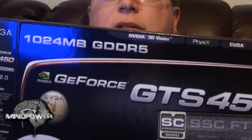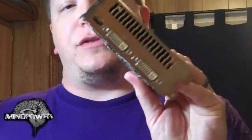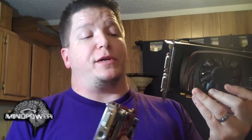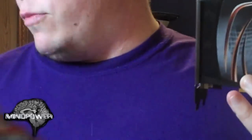The video card I'm going to install here is an EVGA GeForce GTS 450. It's really a rather large contraption — most of it is the fan and the heat sink. It's sort of a wind tunnel and you can see that it's got exhaust vents out the back. This particular video card no longer has the S-Video out, which I didn't use anyway, but I do use the DVI outputs. On this one it's got an HDMI output right there, whereas the old one required an adapter to plug into the DVI outputs, so this makes it a little easier.